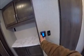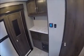When it comes to its desired temperature, or you turn the unit off, it will shut the flame off and run for that same 15-20 seconds. So you kind of start with cold air and you end with cold air, but it does it as a safety precaution. So it'll shut off on its own.